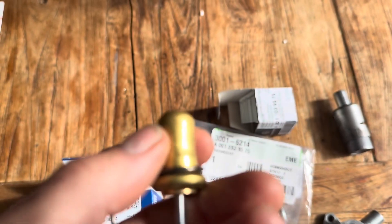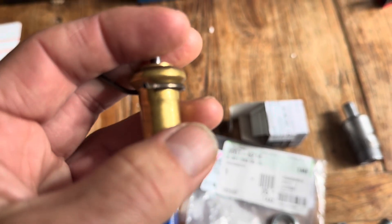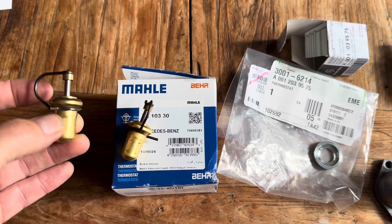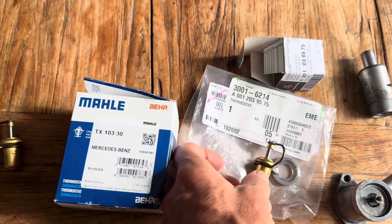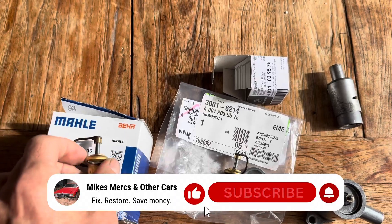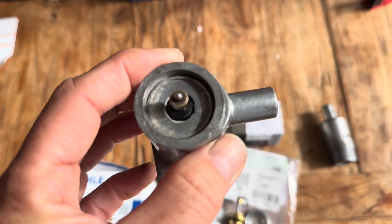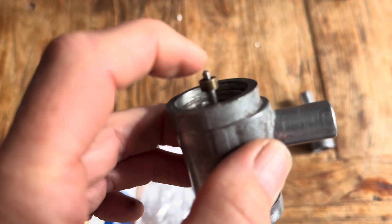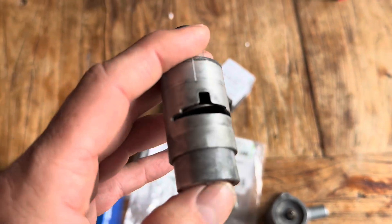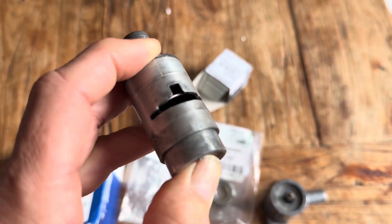For anybody who doesn't know, these little brass bulbs are in contact with the coolant and as the coolant heats up the wax inside this bulb melts and expands and forces this rod up. So we'll be checking to see whether those two rods move up by exactly the same amount, and finally we'll be checking whether the movement of this rod on a brand new bulb is exactly the same as on this unit which has been on a car for 40 years. Because if that rod doesn't move as much as it should — maybe the wax has lost its ability to expand — then this piston will not be forced up as much as it should.